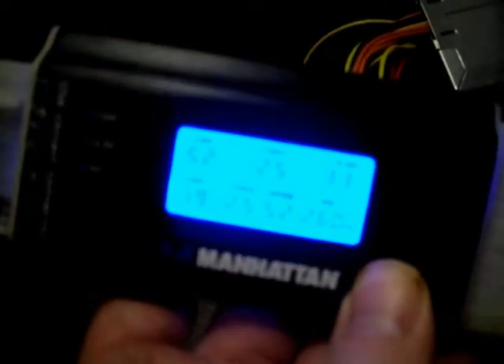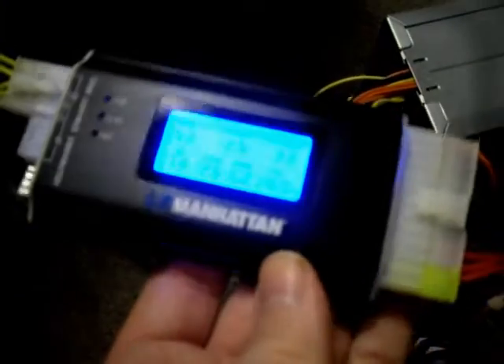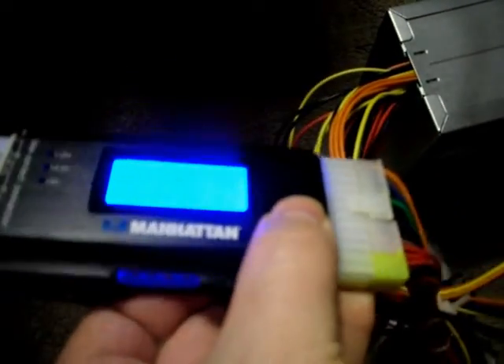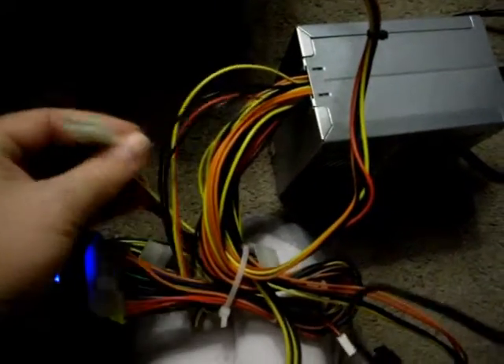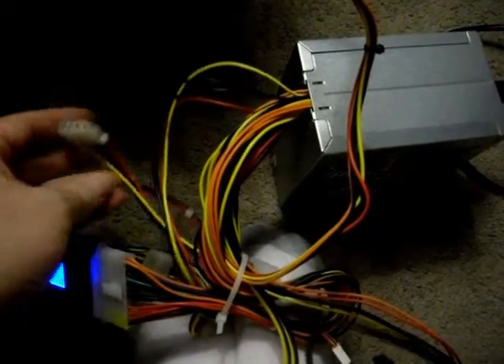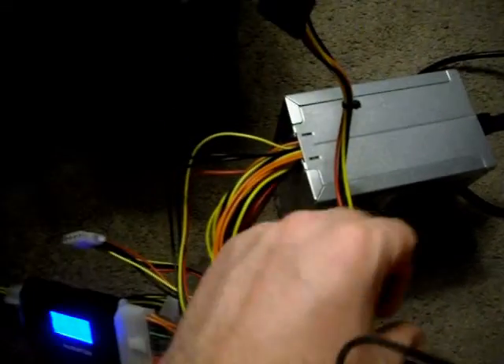I'll show you exactly how that works because I'll hook it up wrong just so that it beeps. But what you'll want to do is test both of the main connectors first. Then you can plug in all of your different cables coming from your power supply — all of your pin connectors to the bottom — and check every one of them to make sure every one of them is working properly. If one's working, they probably all are, but you can check every single cable and every single SATA cable.